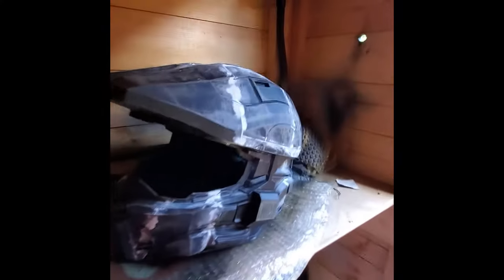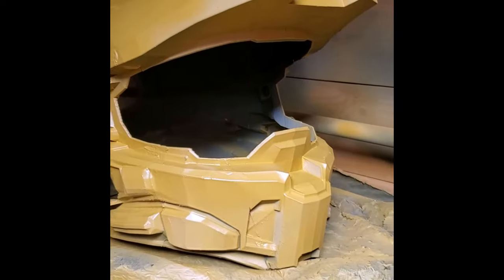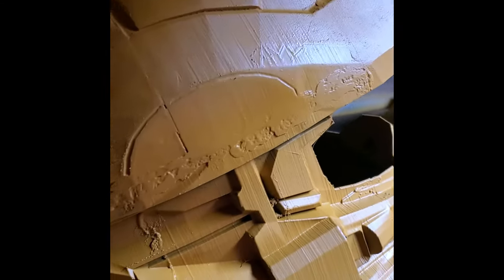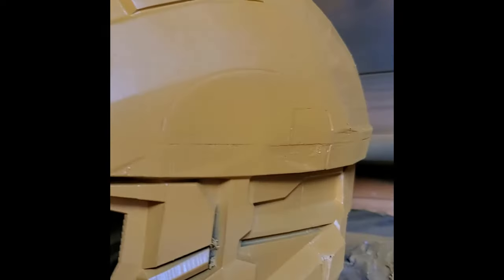What I'm using for this is some plain old Halfords filler primer. The first layer of primer is on and it's covered a little bit better. There are some areas where you can clearly see the sanding wasn't done — and that's fine, that's one of the reasons we put the primer on, just to highlight those areas so we can see them easier. Then it's easy enough to give it another layer of filler, or definitely some more sanding, and that will get rid of more of the imperfections.